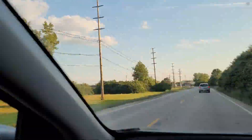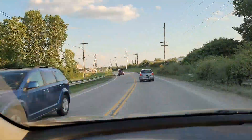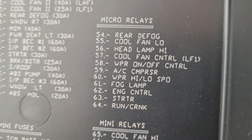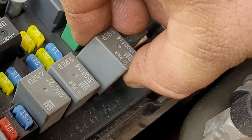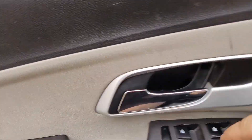Now we're headed to the last call of the day — a 2010 Chevy Equinox that can't get the vehicle to start. We're doing a no-start diagnosis for 65 dollars. On scene we started our diagnosis and could tell the starter wasn't working. Instead of replacing the starter, you need to check the starter fuse and the starter relay — it's number 63. Numbers 61, 62, and 63 are the same size relays, so you can swap one out with another to check the relay. That's exactly what we did. We swapped two of them around, got in the vehicle, and it started right up. It wasn't the starter — it was the starter relay. We went to AutoZone, got it for 10 bucks, and put the new one in.